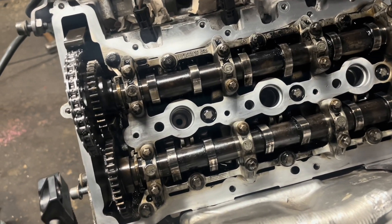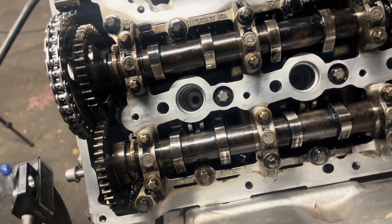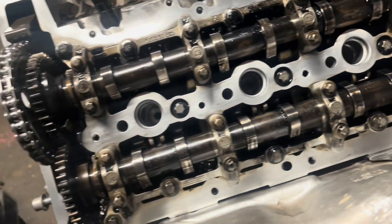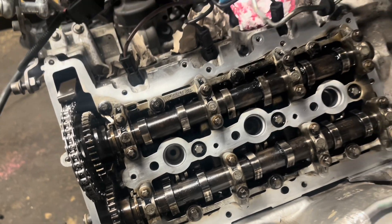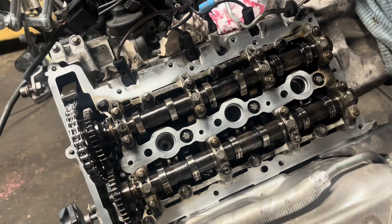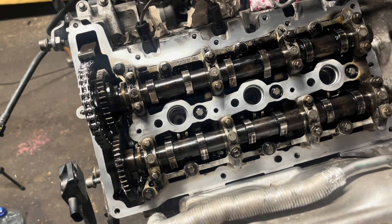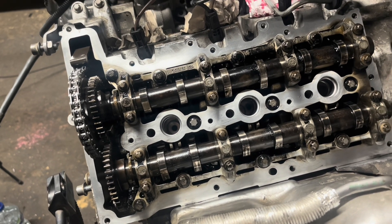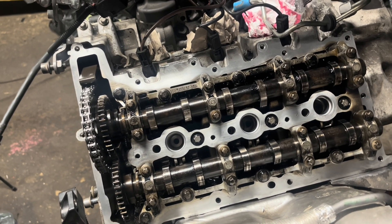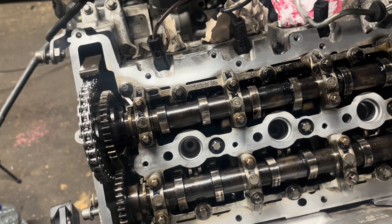After many minutes of cleaning, this is how the injector holes should look — it is sparkling clean, also around the seal area. A successful job lays in the details. Because if you spend some time cleaning and re-checking everything, you have a successful job. If you skip these steps, it's going to leak. So just wanted to show you this is how it should look.